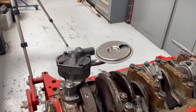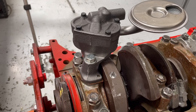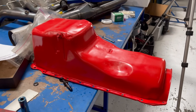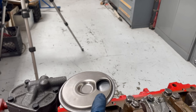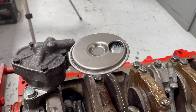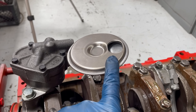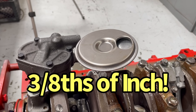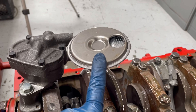We've got our oil pump and the pickup, got that mocked up. What we're going to do is check the pan and see what the depth is. We'll put some clay on there, put the pan on, see what our depth is, make sure the pickup isn't touching the bottom of the pan or too far away. We'll mock it up and check, then tack it into place once we have it in the right position.